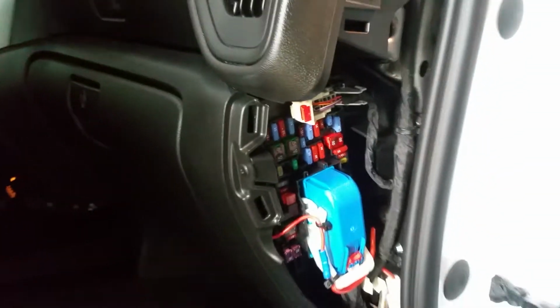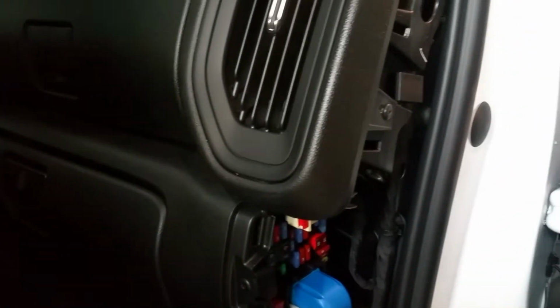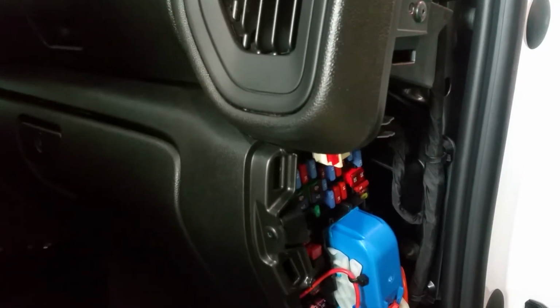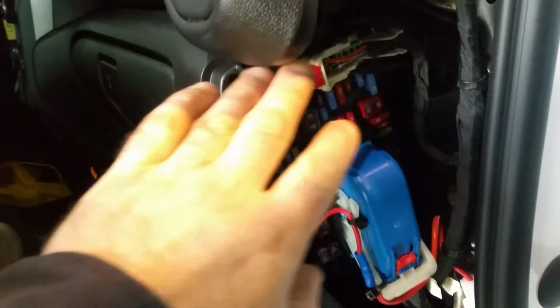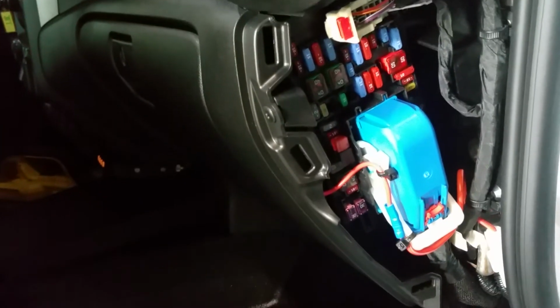So why do I use this fuse panel? I rarely use the fuse box in the engine compartment, because logically the engineers want to separate the two circuits. The engine has different circuits, sensors, powers, pumps, whatever it has there, and those keep the engine running. So if you blow a fuse here, in the fuse panel just for the driver environment, you don't affect the health of the engine. You can get home, fix your lights or whatever you do, and the engine is still running.